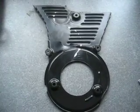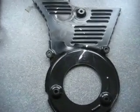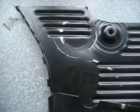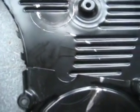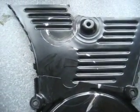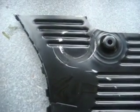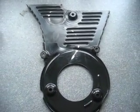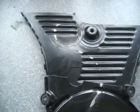This is proof that the water pump caused not the majority but 98% of the problem. I'm sure the tensioner had to be changed and the timing belt literally ripped in half because of all the pressure from the bearings falling out of the water pump. The bearings started to rattle up against this lower timing belt cover — you can see a really good gash there.